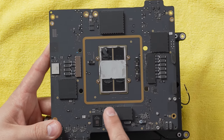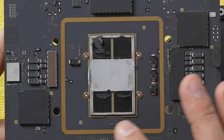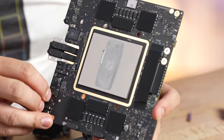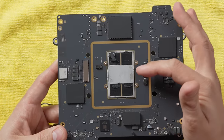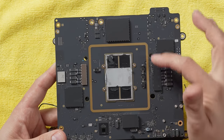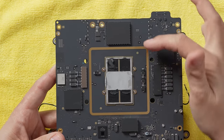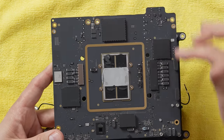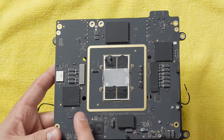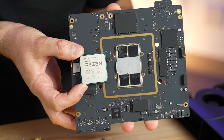You can see the memory modules — the RAM — which is why there's different thermal paste. The actual soldered lid for the M1 Max does not cover the whole chip like it did with the Ultra; it just covers the M1 Max die itself. The memory is separate. And you can see this ring showing the size of the M1 Ultra die — look how much larger it is. The whole motherboard looks very empty compared to the previous one.